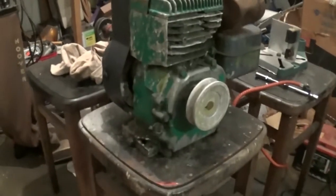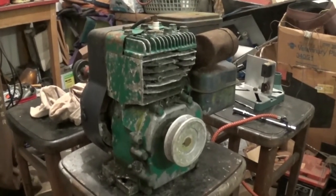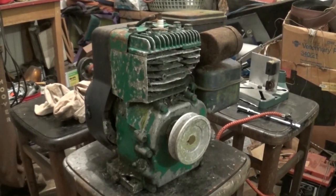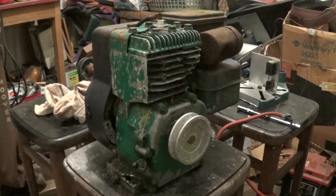This is my project. The next thing is: take the recoil off and sort that out - that's the first job, obviously. And see if we've got a spark. That's the first thing I've got to do. If there isn't a spark, well, we're going to have to find coils and things - so that will be a big hold up. And then the next thing is get it running as it is. It hasn't been running for a long while, as you see.